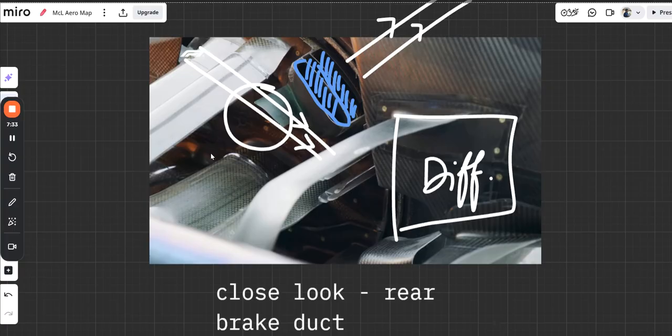When you're able to flow more ambient air, remember track temperature is always a few degrees above ambient temperature. So any air that comes in will always cool the tire. It is seldom that the tires are cooler than the ambient temperature; it's usually the track temperature or above. So when this happens, you've got a higher amount of air coming in that is more ambient than the track temperature affecting it. Because you have a lower carcass temperature, the amount of heat transferred to the tire core will be lesser, leading to less physical degradation. Yes, the thermal degradation effect will also be lesser, leading to overall lesser wear of your tire.